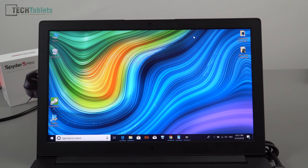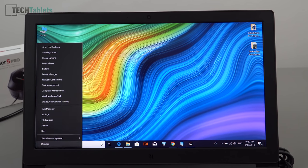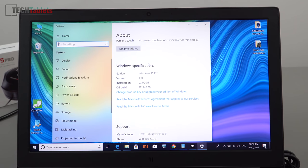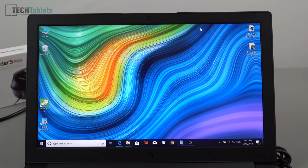Setting it up in English took quite a while. The method I used was to upgrade to Windows 10 Pro by adding a Pro key I bought off eBay, then adding English. I have a video on how to do this — there's a link in the description. Alternatively, a clean install will work since the CD key in the BIOS will pull through and activate Windows 10 Home automatically. It's shipping with Windows 10 version 1803.